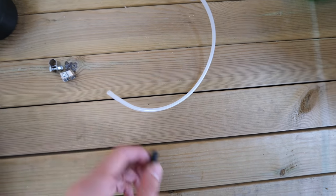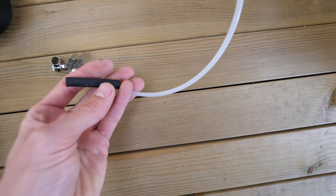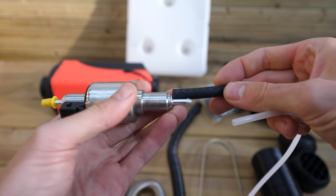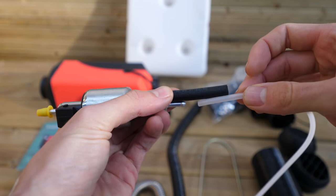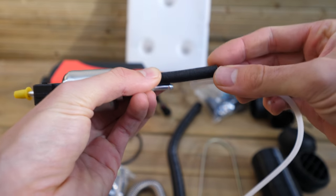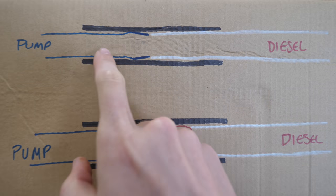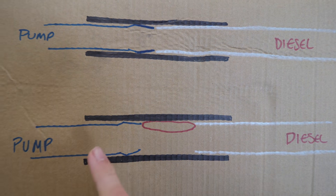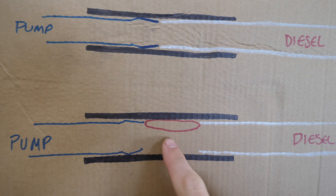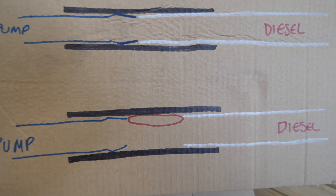When you slide the hard nylon tubing into the braided hose, make sure that when you install the braided hose over the fuel pump, the actual fuel line goes all the way up and touches the end of the connection point inside the braided hose. You don't want a gap. In the diagram: the black is the braided hose, the white pieces are the hard nylon fuel line, and the blue is a connection point. Push both ends into the braided hose so each end is touching — if there's a gap, you'll get a potential air bubble, and you don't want that.